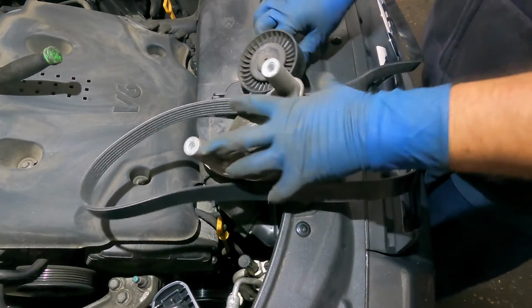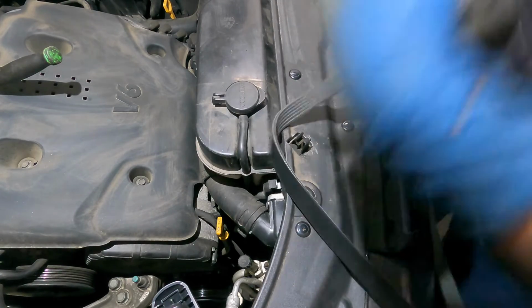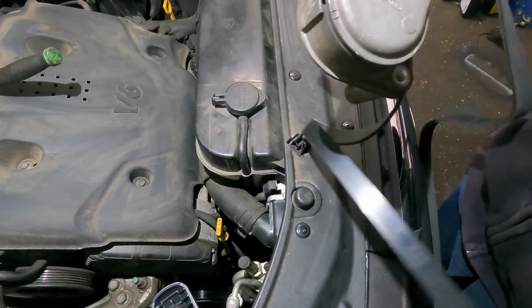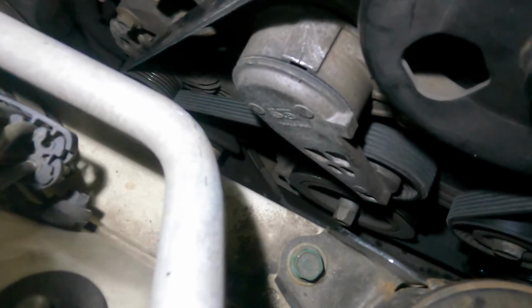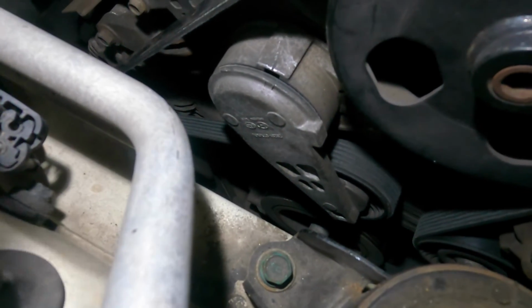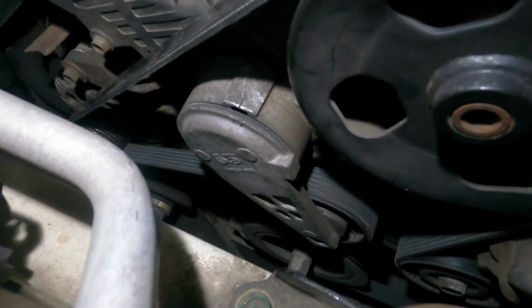The thing went in like butter. Anyways, so we got this in. So what I'm gonna do is the tensioner goes back in and then we'll lock it up. Okay guys, so this is done. So remember, we had to loosen that tensioner rod because it reroutes the belt right behind it. So the only way to get it out is either loosen it a bit or take it out. You see me do it.